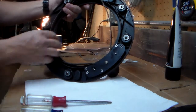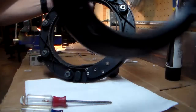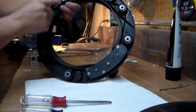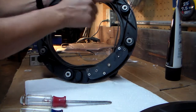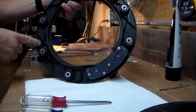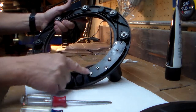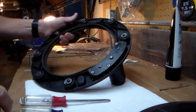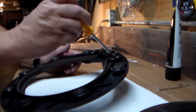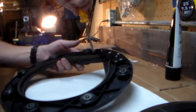This is the inside then of the wheel pilot. So this is your belt drive, runs inside here, makes contact with this, and that's what steers your boat. There's these little round rollers. These can be cleaned, I suppose lubricated a little bit if they make a lot of noise. But for today, we're going to open up this assembly here. Make sure you get a screwdriver that fits these screw heads really tight. You really don't want to strip these out.